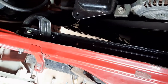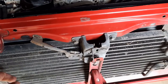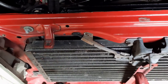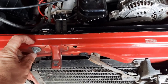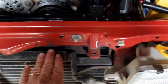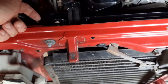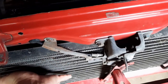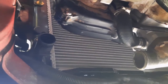The bottom radiator hose I've got on order so I won't go into that until I know it works. For front-mounting the cooling fan there's nowhere on the air conditioning core to mount it to, so I have to mount it to the chassis. I've grabbed some M8 bolts, about 20 millimeters long, and put them in the original radiator holes - their job is just to hold the panel in position. The bolt head on the inside isn't actually touching the radiator, especially important on this side where it lines up right with the plastic tank.